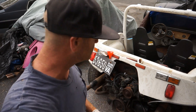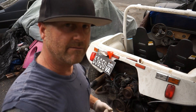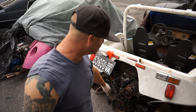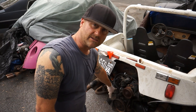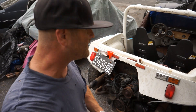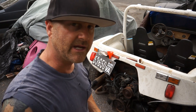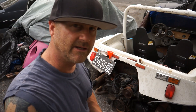If that thing's frozen up, like the one I got out of yours — I'm going to throw a 1300 in that, but that motor's seized up. If it spins, go ahead, roll the dice, gamble, beat them down a little bit on price, get it home, and start messing with it. Check out some of my videos and other videos on getting things running. We've got some on the points — how to set and gap the points. Always replace the points and condenser. If you've got a message or need something, hit me up — I'll respond back to what I know. And if I don't know, I'll ask around and find the answer for you. Keep it Two Guys Out — appreciate you checking out part two of this abandoned sand buggy, abandoned for 12 years.